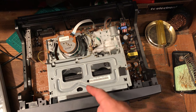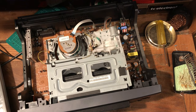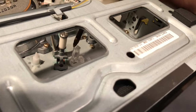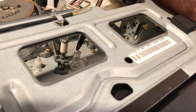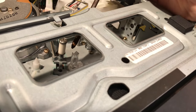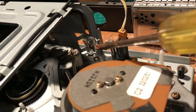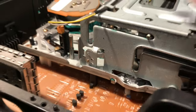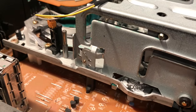I could just disconnect these light sensors completely, but that's going to mean when it gets to the end of the tape it'll pull the motors and pull the tape, which is not a good thing. So we've got to manage the ambient light somehow. Down in here you can see this acrylicy-looking thing — that's a light pipe coming up. It's not the actual infrared LED; the LED is down somewhere and this comes up and shoots the light out. On either side you can see another light-pipe thing, and that's where all the light is received from the central infrared emitter.